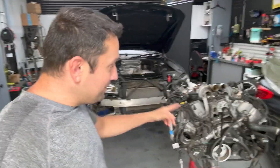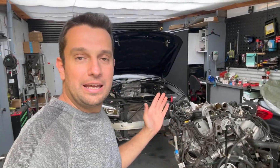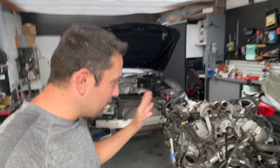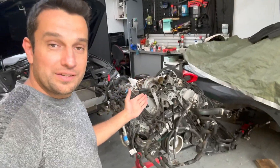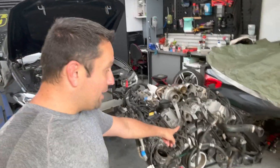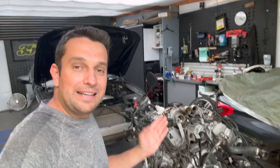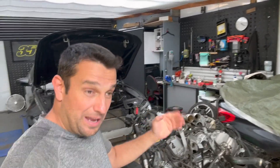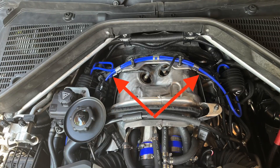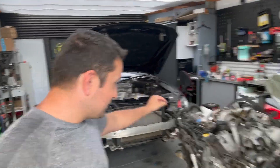the vacuum reservoir and the solenoids. There were a few people messaging and emailing me because it's very easy to get lost when you are either replacing or servicing these hoses. They do perish over time, so it's not uncommon to have boost-related issues because the hoses are cracked or perished, especially on the early versions of the S63 — the X5M and X6M.